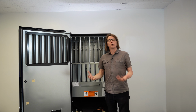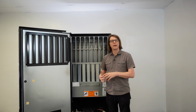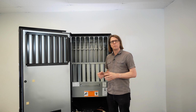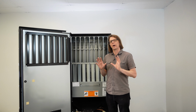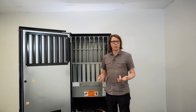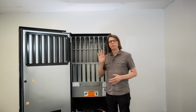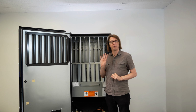So those are the physical adjustments that you need to make for each individual column depending on the product size you're vending. The last thing you need to do is make the programming changes. We need to tell the computer board so it understands how many products deep each selection is. So for example, selection number 1, which is having our 12-ounce cans, that needs to be set for 4 products deep. So we're going to set the set depth setting for that to 4.